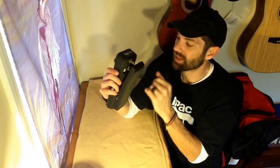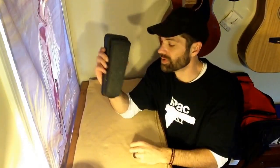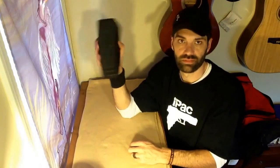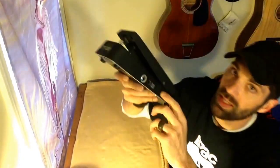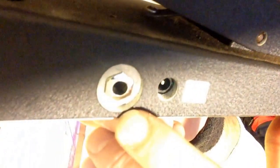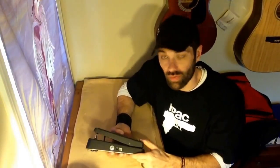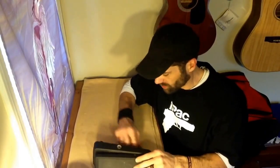Wiping the dust out of it and things like that — some of these electric components in here are exposed. When you're wiping this down in here, be real careful about that. Also, dry it off. Don't leave it wet. This is cast aluminum on the housing. Down in the bottom of here, you can see where it looks whitish, chalkish — that's where this aluminum is corroding. Yes, aluminum will corrode. We'll clean that up as well.